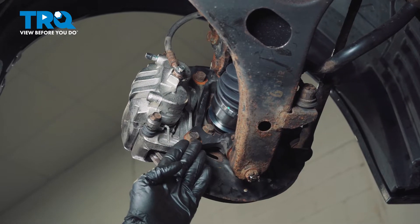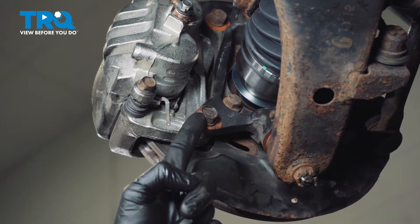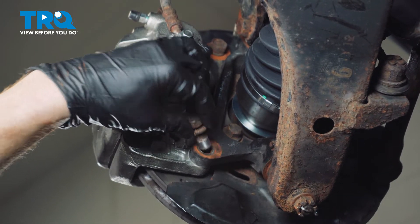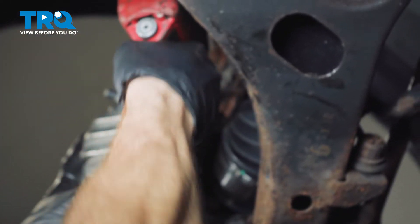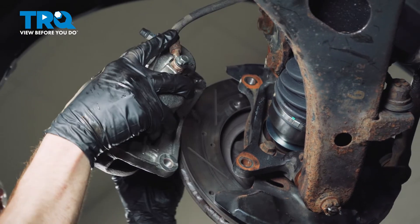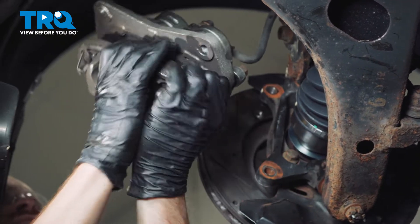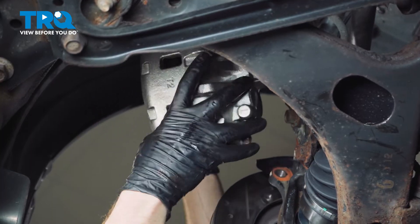We have to remove the caliper and the caliper bracket from the steering knuckle. For this, you'll find that you have two 17mm bolts holding it in place. Remove the pair and then carefully remove the caliper, removing the upper bolt and sliding the caliper out of place — be careful of that brake rotor, we don't want it to fall off and potentially hurt us. Once you have the caliper off, it's always a good idea to take a peek at your brake pads. You have an inboard pad and an outboard pad — make sure they're not worn at a funny angle or damaged. Set this caliper aside, making sure that you put no pressure on the flex hose. We don't want to damage that as we continue our service.